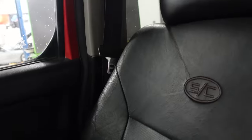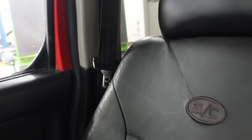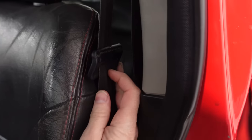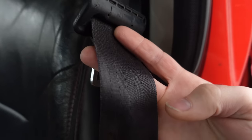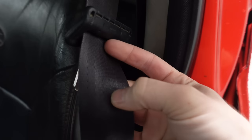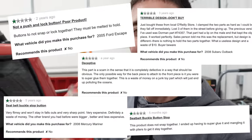These seat belt stops are just a few dollars and the kit comes with a ton of them for different cars — tan interior, gray interior, different colors. How these seat belt stops work is very easy: you just match up each seat belt to the other side, find the factory hole or somewhere right in there, put the seat belt stop through — it's got a little needle — and then you just snap the cap on. Well, this is one of the few times in life I'm going to say never ever buy this product. The Dorman 74358 should be discontinued — I don't even know how they're still selling this.